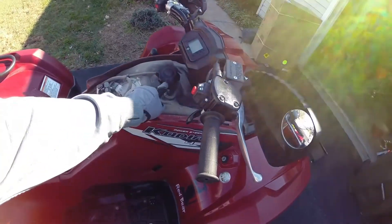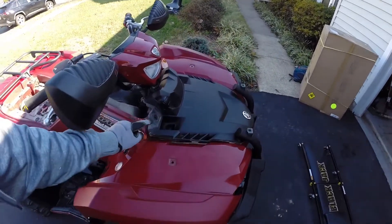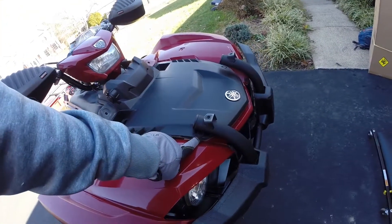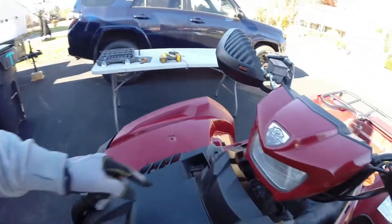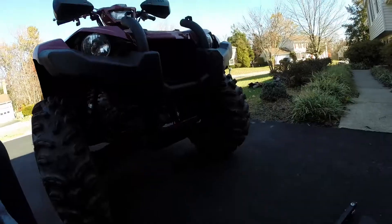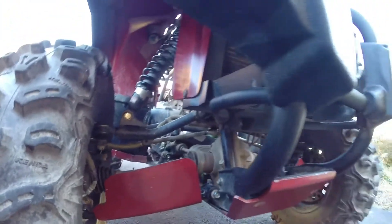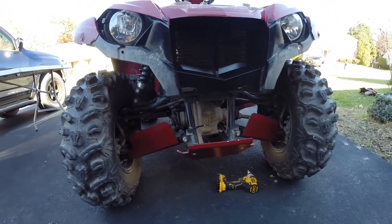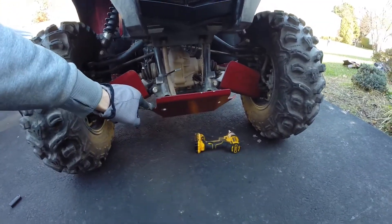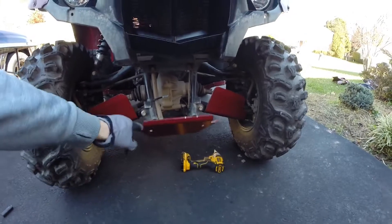Once that's done and you've reinstalled your gas cap, now is a good time to disconnect the negative terminal. Next take off the top cover which is retained by clips — two clips you'll pop out with screwdrivers up front, but be careful because your 12-volt is connected so you'll have to disconnect that as you remove it. After that the side panels just pull right up and out. Then take off the front bumper piece — four 12-millimeter bolts, one here, one up top, same on the other side. Note: I also had to loosen my Ricochet off-road skid plate to get the front bumper off.